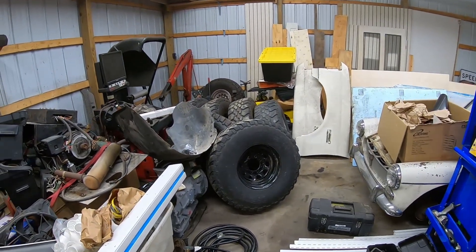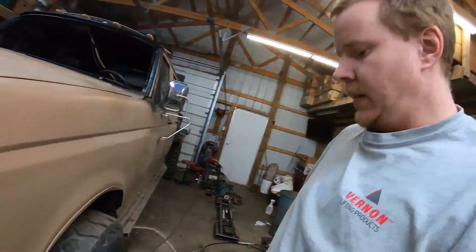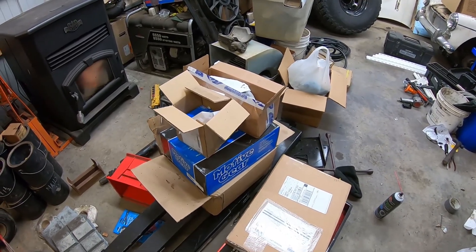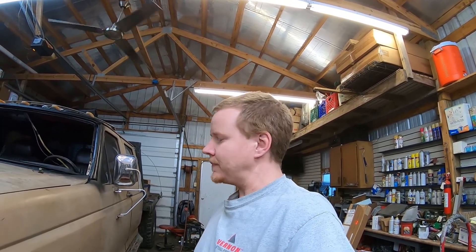Just got the final coat of epoxy primer on and I'm pretty happy with how it turned out overall. Everything's sealed up and smooth — I think it's ready for the windshield. Hopefully they'll be out in a few days to get it put in. I've got new fenders and new tires sitting over there, and we'll be cutting this front end out completely — new springs, new gears, every nut and bolt, all steering linkage, steering box, everything's getting replaced. We rebuilt the rear end last year, re-geared it to 4.88s, so we need to get the front done so I can get the front driveshaft rebuilt and actually have four-wheel drive again. It's coming along slowly but surely — thanks for watching and please subscribe.